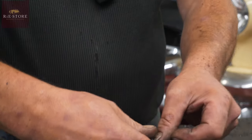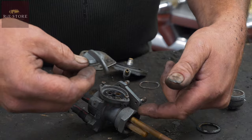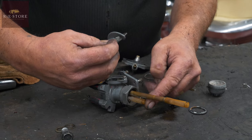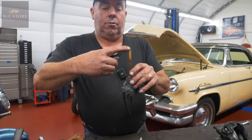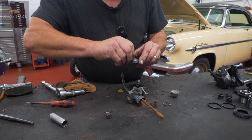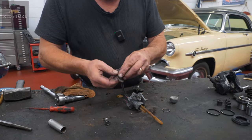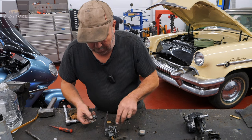So you've got off, which won't let the fuel go. Where the fuel comes down here, that's your normal, that's reserve. So that height in the tank — if you've got the fuel on, it will run out of fuel when it gets below that level. So then you can turn that all the way round: that's off, that's on, that's reserve. So that's putting that slot in different places on there, just letting the fuel distribute.